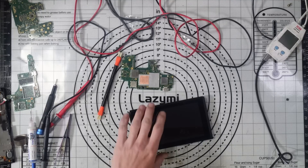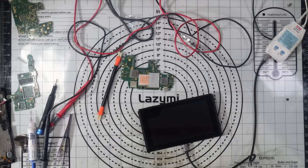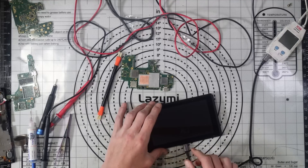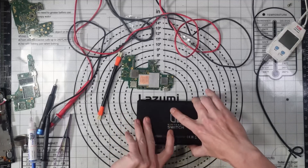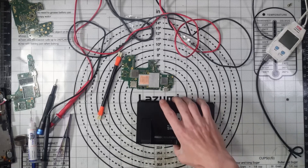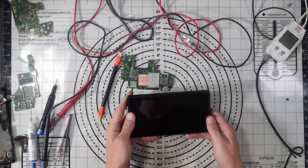This is going to be fairly straightforward. I assumed it's a 2101 error code, but we are stuck at 5 volts 80 milliamps. It's not a 0001 error code then - stuck at 5 volts at the M92. Given that this was reported as a 2101 error code, I'm 99% sure we're just going to have an M92 issue. I cannot turn it on.